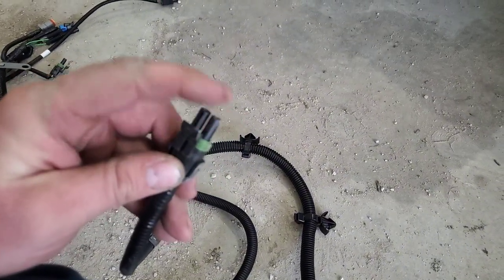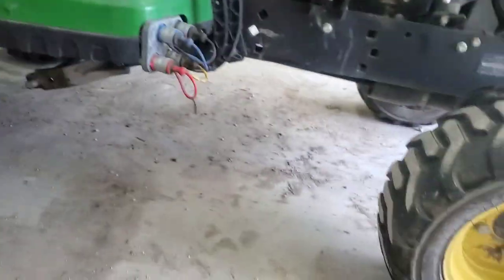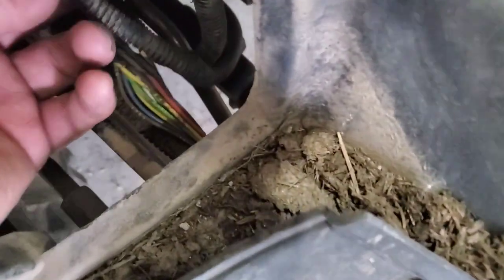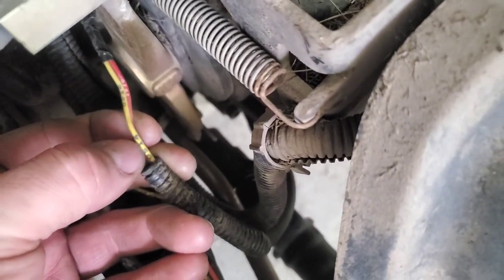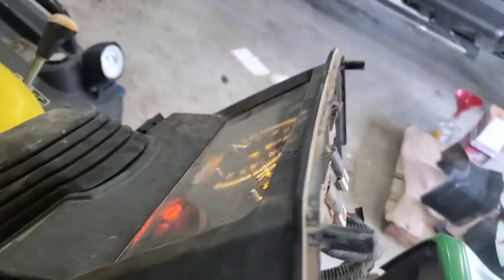This right here is the plug — this is where my troubleshooting starts. What I'm doing here is tracing the wire back as far as I could go. It got into the main loom, so it's hard to trace, so I looked at the wiring numbers. The red wire is the power supply and the yellow wire is post-switch. It makes a home run all the way up to the dash — to this wire right here in the back of the dash — to let it know it's in neutral.